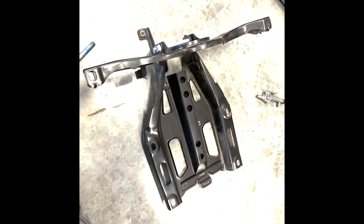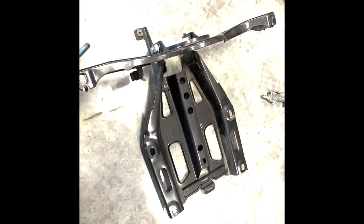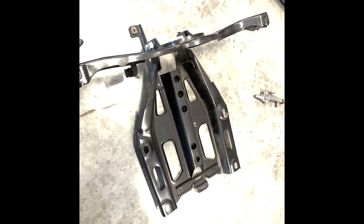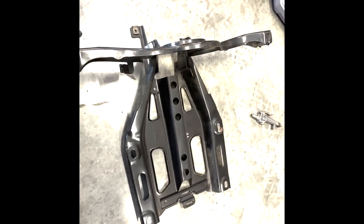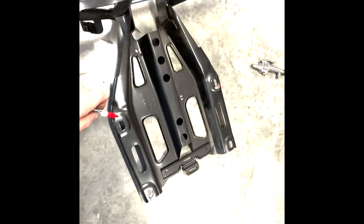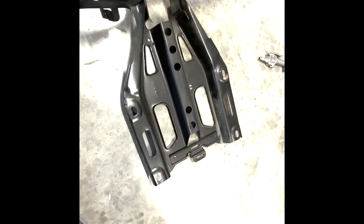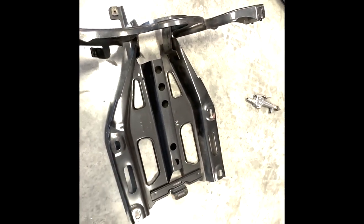Let's talk about the motor cross member brace. As discovered, if you don't modify the transmission mount, the engine is to the rear — it's doable, but kind of sucks. Sounds like these holes here have to be notched out an inch and a half, which is a big notch for both of them. So that's an inch and a half on those ones so that it can go forward — you've got to notch it that way because it's going to go that way.